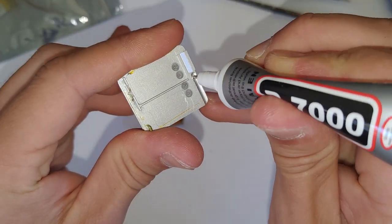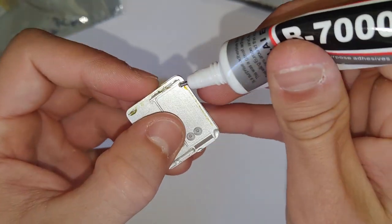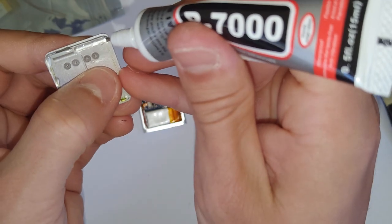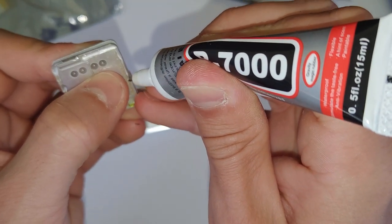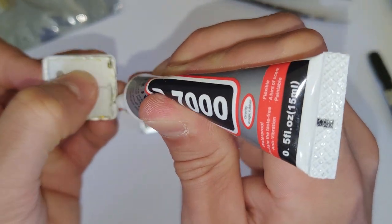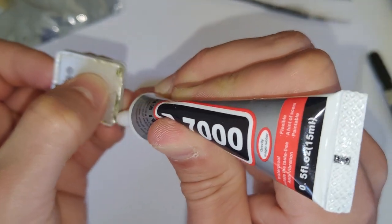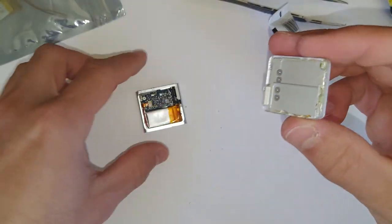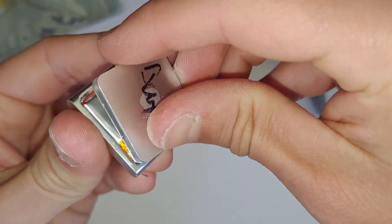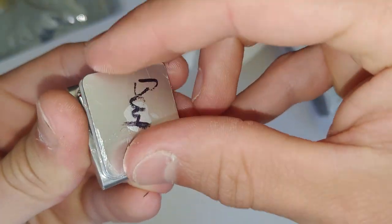Putting the back on — I like to use super glue, not the hard drying stuff. Use a phone-specific super glue, something that dries rubbery. I like to use a glue called B7000. That's probably the best glue you can get for phone repairs, because if you ever do need to open the device again, you will be able to. A lot of super glues just make that impossible. Just go all the way around the outside and then put the thing back together. You have to put it in a specific way because one side has clips and the other side has a little locking thing — you'll figure it out when you see it.